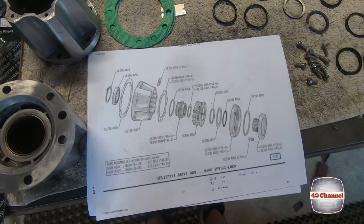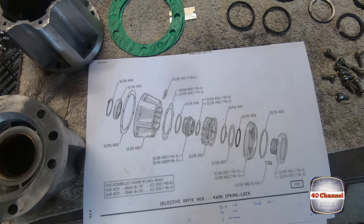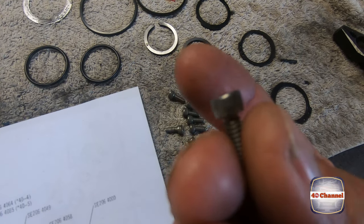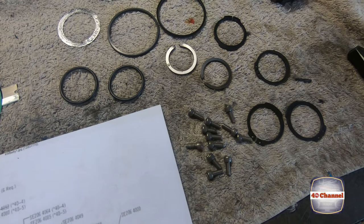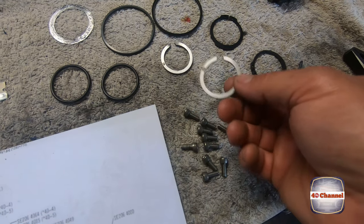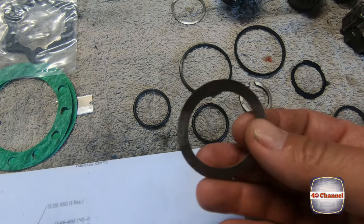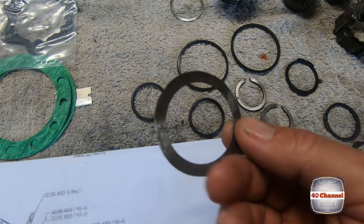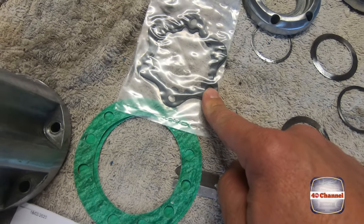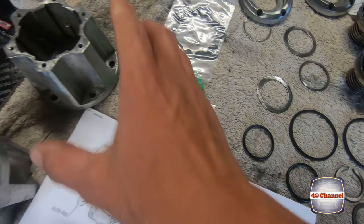So I was able to find this on the Mighty Web, and from that I was able to figure out what I needed. So we got 3/16 UNC stainless steel, brand new circlips, new snap rings because there was one missing on mine already, new O-rings, quad rings, the shims I cleaned up, I soaked them in some rust remover and gave them a bit of a polish up, new gaskets, front and rear, as well as some new roll pins as well,